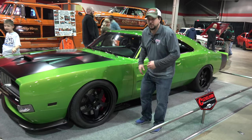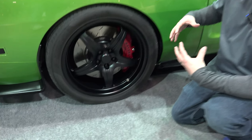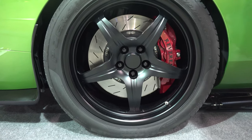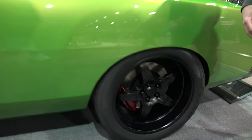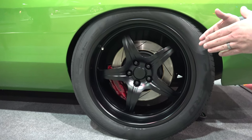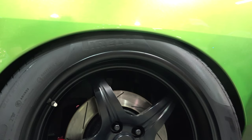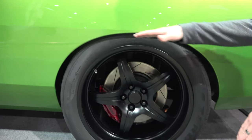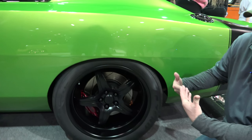So our wheels we use on this, they're a CCW monoblock wheel. What that means is it's basically one chunk of aluminum cut down. It's a 20x9.5 front wheel, and our backs, we want a 20x12. So meat-wise, when you're running something this big, you want to make sure that you're getting enough traction down to the road. Inside-wise for suspension, because we have an independent rear suspension on this, we basically channeled the inside frame, the unibody, just a little bit, but didn't go crazy because we wanted to make sure everything's in there. Obviously, all you true Mopar guys out there know that normally these wheel wells have been altered a little bit. Sorry, purists, we had to, because unless you're running 15-inch tires, we didn't have a choice.